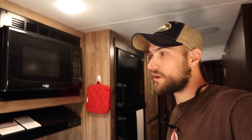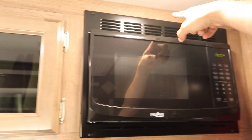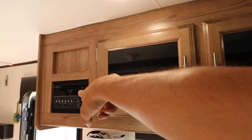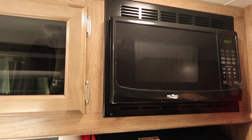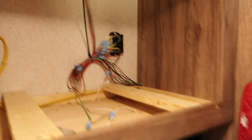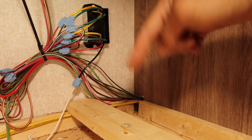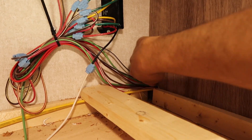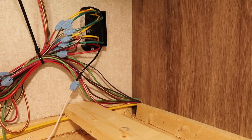Here we are inside the camper. Here is the fridge — I just took off the vent cover from the back. I'm planning to run that cord down into this area with the radio because that's all got 12-volt. I had to take the microwave out to figure out how to get the cable from this cabinet into the next cabinet area. With the microwave out, you can see there's a hole with a bunch of wires running from the fridge cabinet through, so I'm going to try to jam the cable through there using a fish tape.